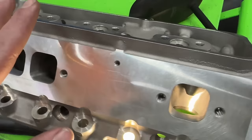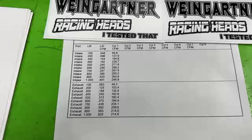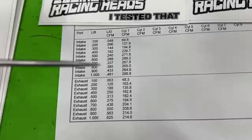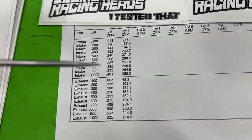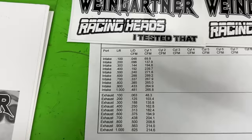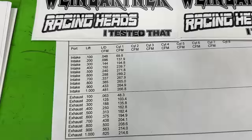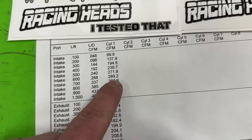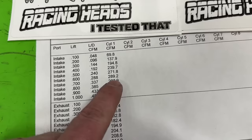I hope I haven't beaten you up too much. But I know you want to see the flow numbers, so let's go ahead and look at those. Here are the flow numbers - this was tested on a 4.155 bore because he said he was building a 377, which is 4.155 bore, 3.48 stroke - a 400 block with a 350 crank. The numbers I care most about, and I've said this several times, are 400, 600, and peak. At 400, it's 239.7 - we can call it 240. That's pretty good, not too bad at all. At 600, it's 289. And right away you're like - wait, you had 2.68 CSA at the short side, which usually flows 268. Well, if you keep looking, after that it is 268. It's 268, 265, 267. At 600 it's 289, but it does fall off after that.